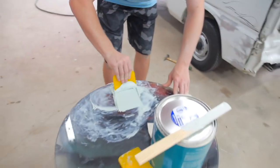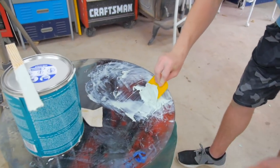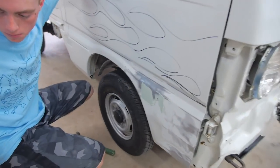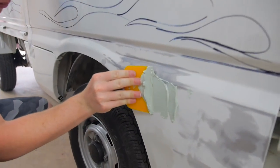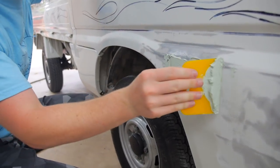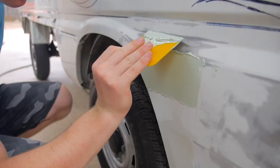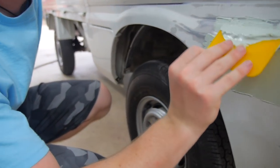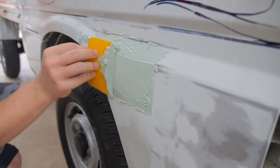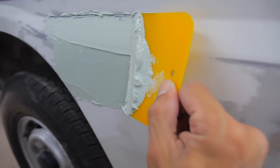First time doing filler is always tricky. I think you mixed it enough. Right. So, there you go. Good, that's good. Do the top. That's all you need. A little bit more, and then grab this edge, go that way. Right here? Yep. And then do the bottom again. Yep, like that way. You might want to grab it like this, and maybe you can go this way as well. Sometimes it doesn't fill, then you got it, there you go.